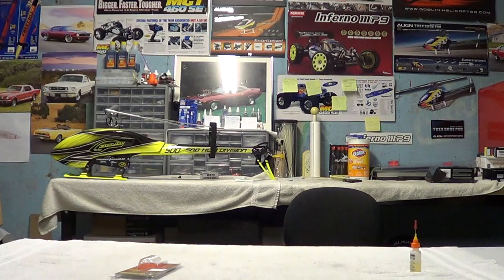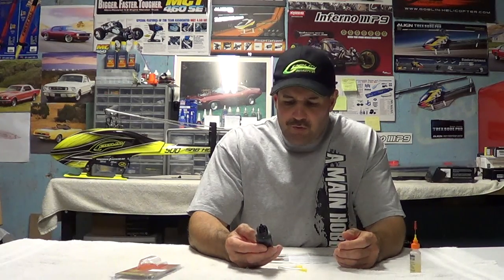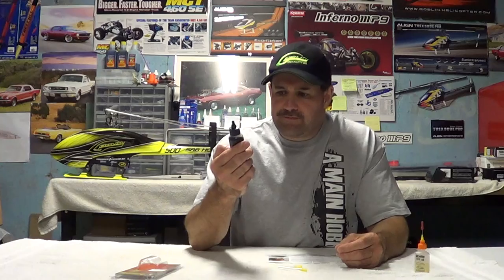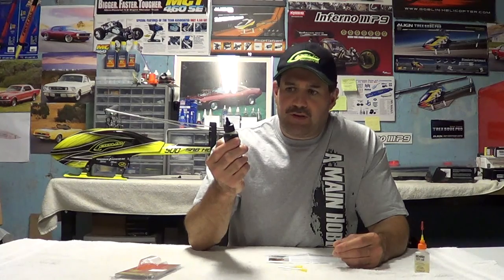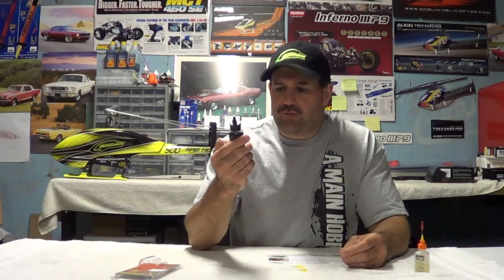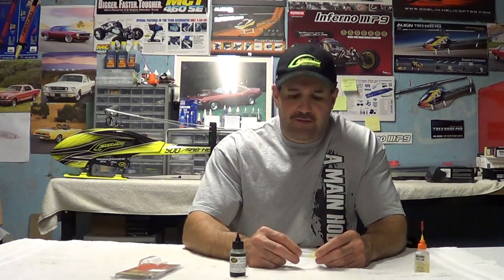So it's very important to keep these bearings oiled. It really does keep them from wearing out. These bearings really should last forever almost, if you do keep them lubed up and oiled. These bottles of oil are like eight, nine dollars, so it really doesn't break the bank. They say to put one drop of oil on each motor bearing — I put more than that. I put at least two or three or even four drops around that and let it seep in there, turn the motor and it goes right inside the bearings. It is important to do. It will keep you from having any incidences and any failures.